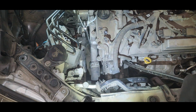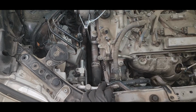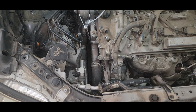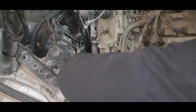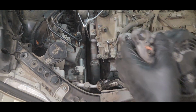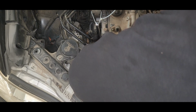I'm releasing the tension of the bush where the alternator is held, and then pushing the alternator a bit backward. Then it's easy to access the bottom bolts, which is where I'm putting my hand in. There's a 12mm bolt. Once you remove those 3 bolts, there you go. You have access to remove the alternator out of the engine. From this, you don't need to remove the front radiator support or radiator, just the radiator fan assembly. As you saw, I'm just fitting the new alternator back in.